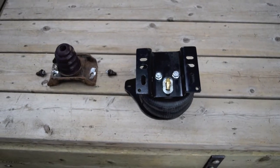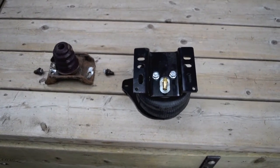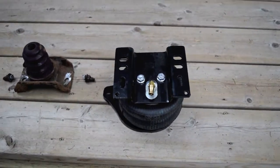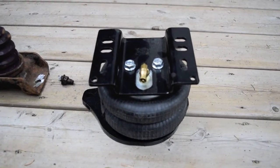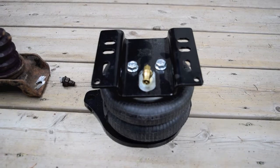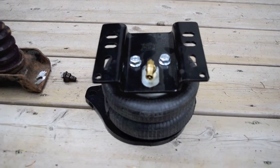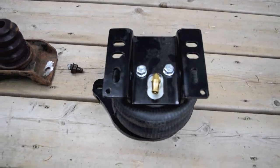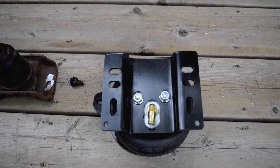In this case it's the driver's side. I've already done steps 2, 3, and 4 — attached the bottom and top plates to the airbag, and I've got the air fitting on. The air fitting is pointing to the inside of the truck, so it will be pointing towards the leaf spring, and the other side will be pointing towards the tire.